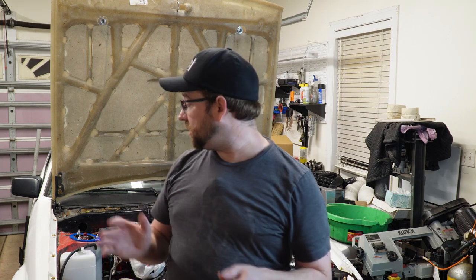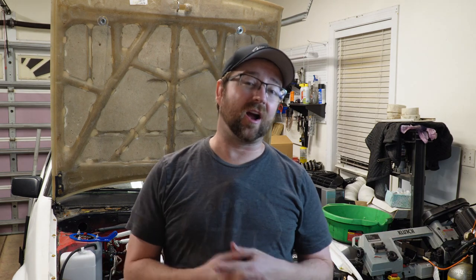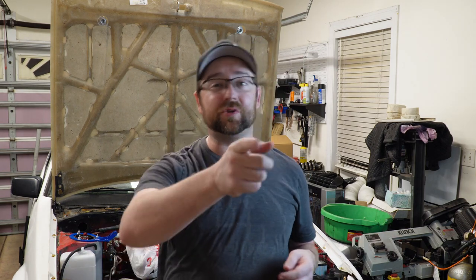And there we go — these are all installed. I'm really stoked about these. They really do solve some problems you get into when you start trying to dial in an AE86. You can adjust your caster without having to trim your fender and bumper, and you've got more camber adjustment. These are a great product to really improve your ability to dial in your steering and suspension geometry — a huge improvement. Seriously, shout out to Annex for finally making these for the AE86. If you like videos like these on AE86 install parts and technical breakdowns, make sure to check out my channel. Like, comment, subscribe, share — every bit helps me make more content for you guys.